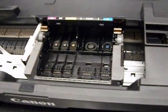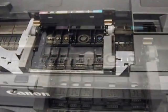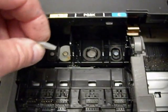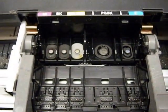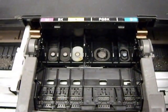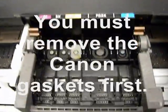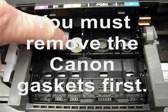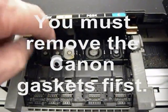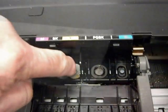Make sure you have some paper towels handy because sometimes you'll get some ink on your fingers or on the printer. With our CIS system, we give you the printhead gaskets. Sometimes you need to use them, sometimes you don't. The only way I know is if I watch the ink in the hose run back to the ink tank — then I need to put the gaskets in. You can just place them down in there and they only go a certain way.